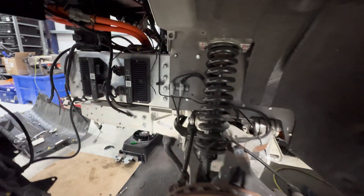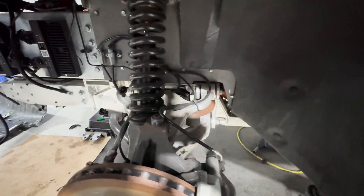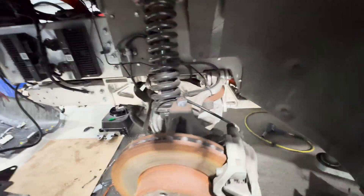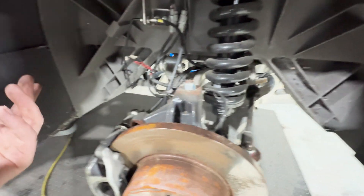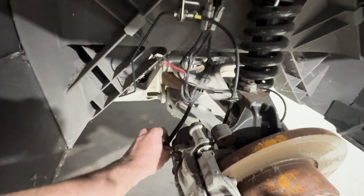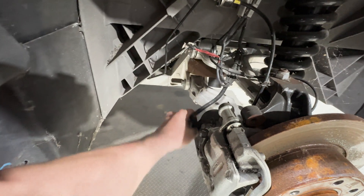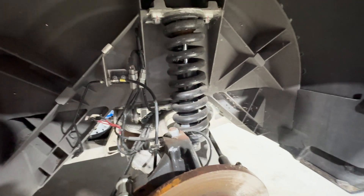So I've popped all the wheels off for a closer look. There are loads of control modules all over the place, pretty beefy suspension, and a steering rack. Brake lines are all in, so I don't know why the brakes are empty - I'm going to bleed all the brakes now. ABS sensors, double wishbone which is pretty good - that'll really help it maybe become a race van or truck. The rear is the same again: really beefy suspension, double wishbone which is great. Smaller calipers also - these are unplugged. I'll plug all these back in; hopefully that means the rear brakes will actually work again because currently I have no handbrake at all.